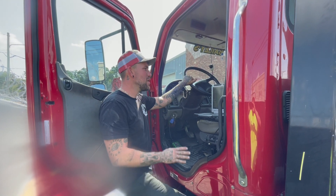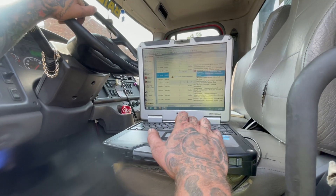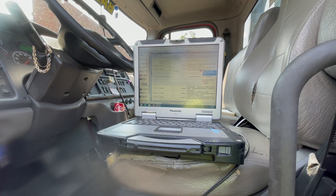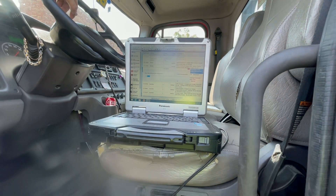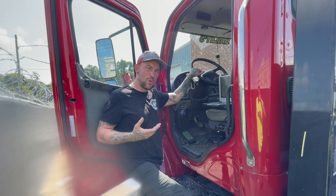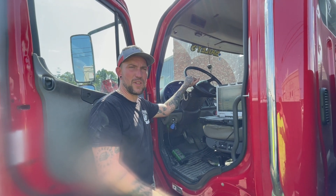What we're going to do now is clear everything out. Right-click on the screen and select Reset All Faults, hit yes, turn the key off, click okay, and it goes through its reset phase — that takes about two minutes. Once it resets, we're going to put the unit into a forced regen. Once it force regens, those after-treatment codes will clear themselves out, and then we can get on the road and move to the next job.